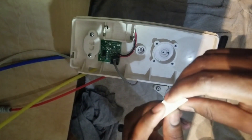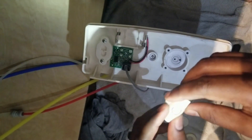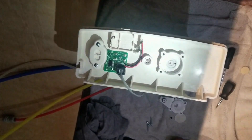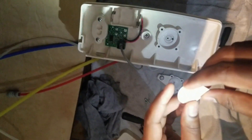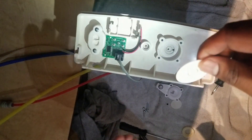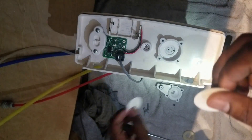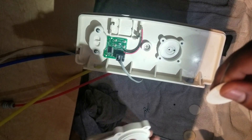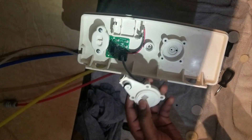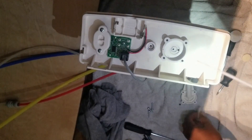That's why the shutoff assembly was not working and was continuously draining water, causing the sound. For Kenmore parts, go to Sears Parts Direct — I'll post all the part numbers in the description. They sell parts individually, but shipping and parts are not cheap. Just the two diaphragms came to about $30 with shipping. They also sell the plunger, spacer ring, and shutoff valve assembly individually, so order only what has gone bad in your case.